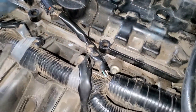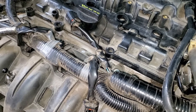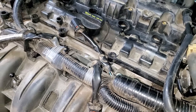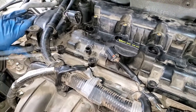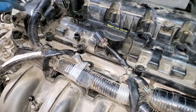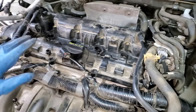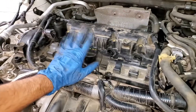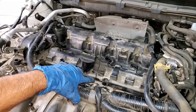I went around gently because you do not want to ruin the surface of the valve cover, and you do not want to ruin the surface on which the rubber seal goes. So be careful when prying — I moved to areas that were still restricted and was able to release the front end. I am going to repeat the same thing all the way around and on the other side. The goal here is, since this is plastic, to be as gentle as possible and not ruin the surface. Use a putty knife and take your time — you will save a lot of time and money if you take care not to crack this.